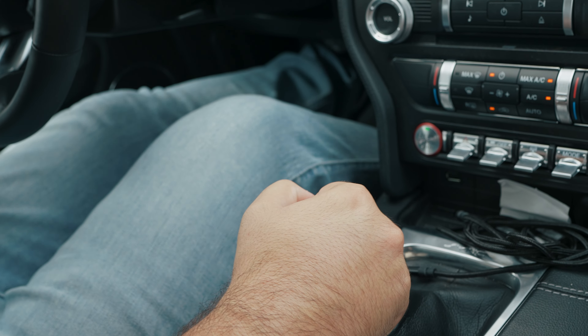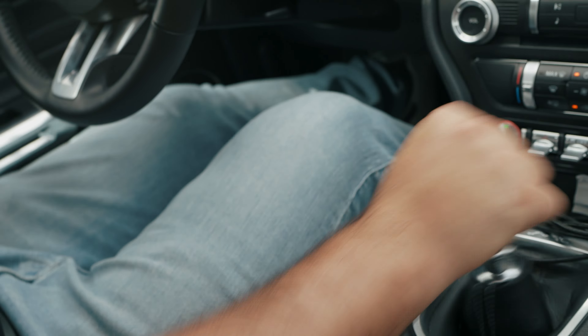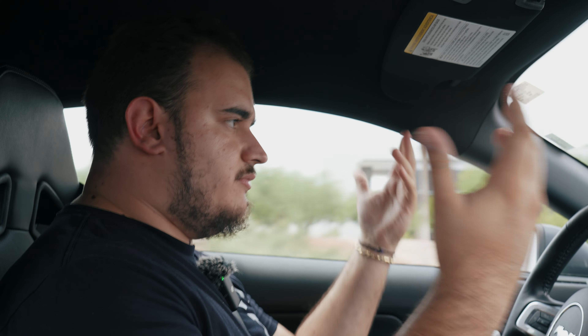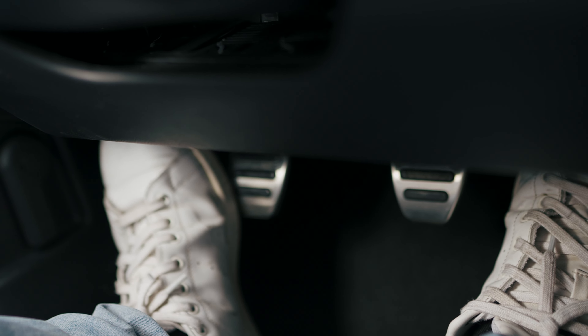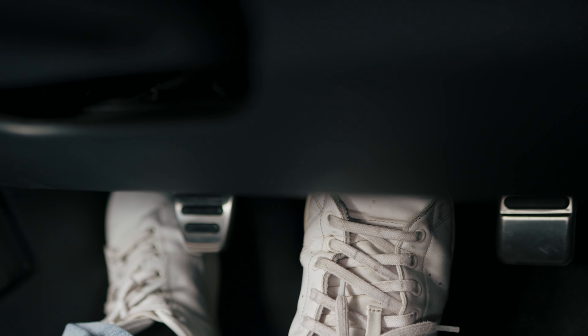So, really cool way. It's very simple. If you know how to drive manual, this thing is going to take you probably three or four tries, maybe less, and you're going to get the hang of it. It's super easy to do. I'm going to demonstrate for you guys one more time exactly how you do it. So right now I'm cruising in fourth gear. Let's say there's an 18-wheeler in front of me and I want to pass him on the highway — you clutch in, put to third, blip the throttle, and then let go of the clutch, and then the car's automatically going to be in the correct RPM. Now, when I say blip the throttle, what I'm talking about is I'm literally just pushing the throttle all the way down — it's like flooring it, but just blipping the throttle once, and then letting go of the clutch after you've blipped the throttle.